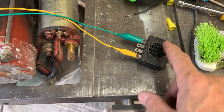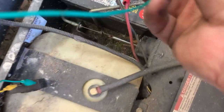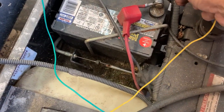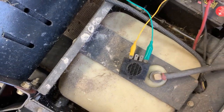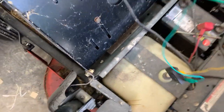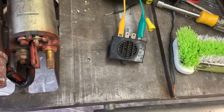Here's the tool I used to diagnose it. This is an old buzzer from a 1970s-era seat belt warning system. Let me hook this up to my lawnmower battery — when you put power on those two outer terminals you get a buzz. I also proved that if you reverse the polarity it works in both directions. It's not an electronic buzzer, it's a mechanical buzzer.